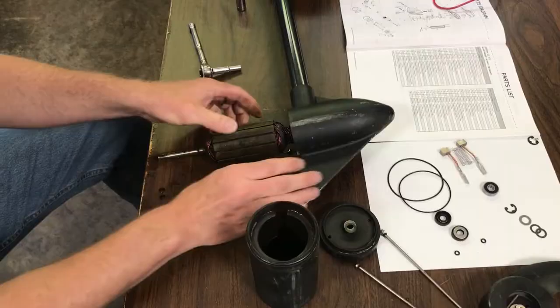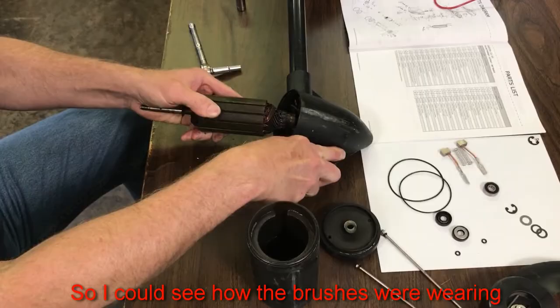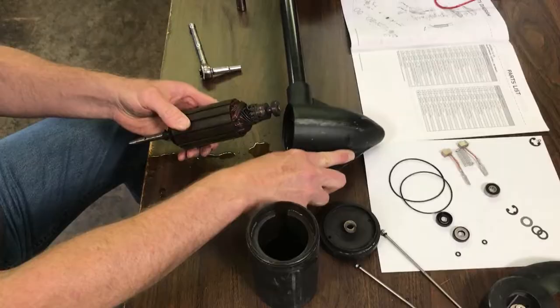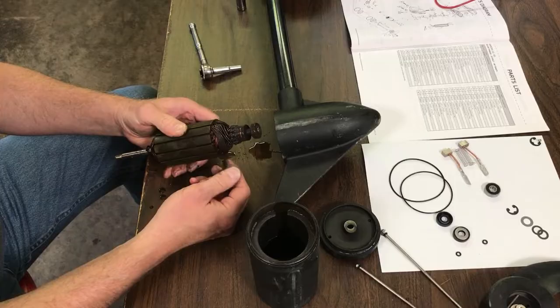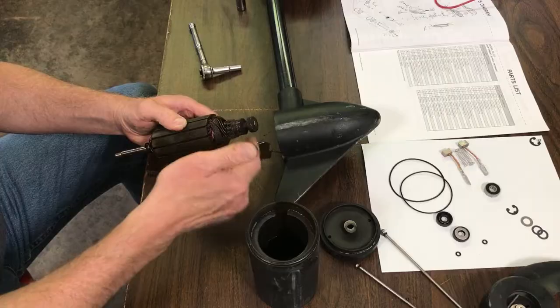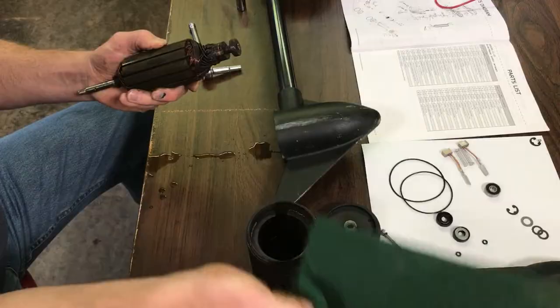On this part you can hold the shaft and pull the magnet out. There's an o-ring here we have to replace, and an o-ring on this one too. I pulled the outer part off because I wanted to try to keep the brush assembly on the armature, but it came out anyway. The armature is pretty dirty — the best way to clean it is with a piece of leather, an old belt, or an eraser. You can use emery cloth but do it very lightly.